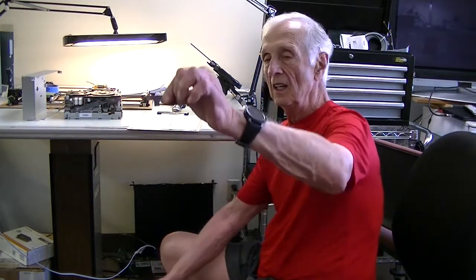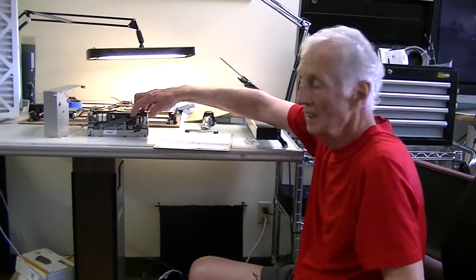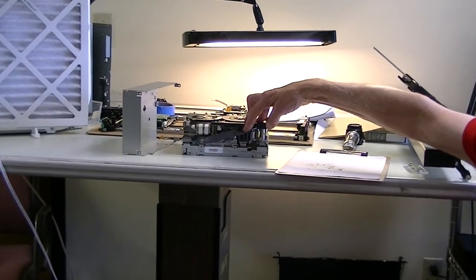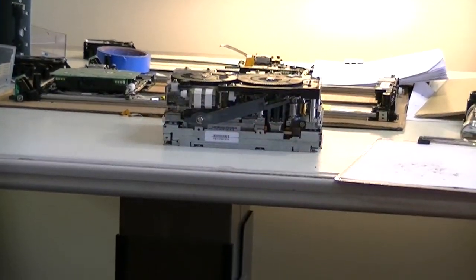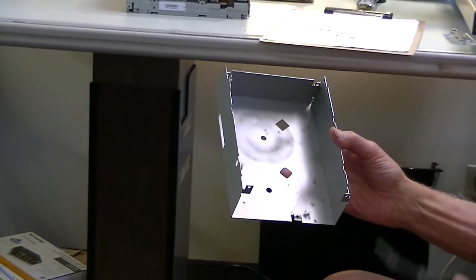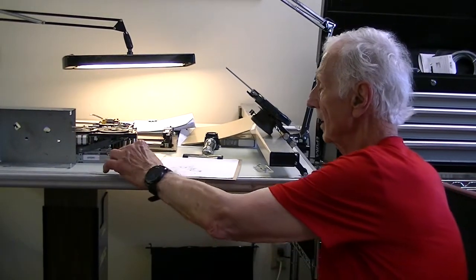What the engineers decided to do is make a little brush. This little brush physically goes up and down on the head when you either load a tape or take a tape out. Here's the device itself on the head, and at times they have it set up to do three passes. So they realized that accumulation of dirt and debris is a problem for tape drives and addressed it that way. You can also see a little bit of debris buildup on the cover of the tape drive. It's caused by a couple of things: environmental contaminants, and secondly, using the wrong kind of media for your tape drive.